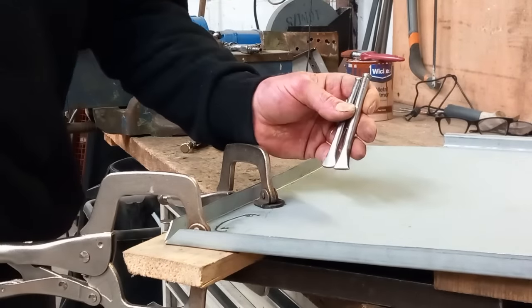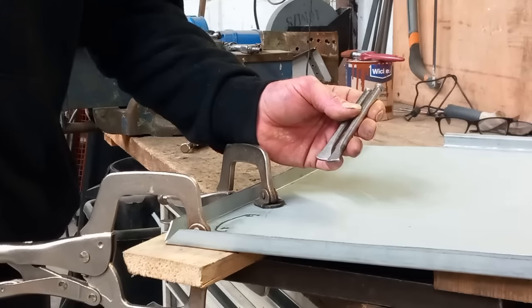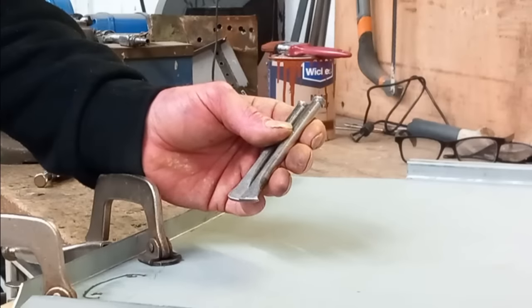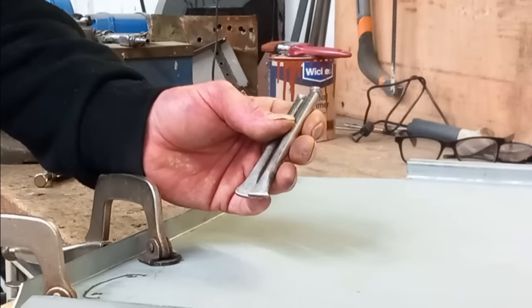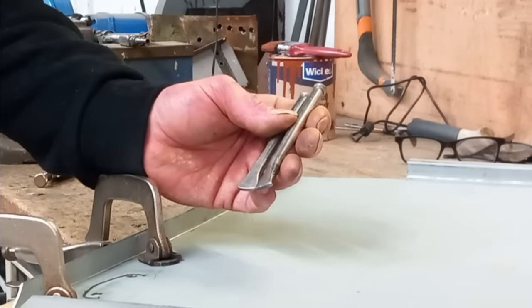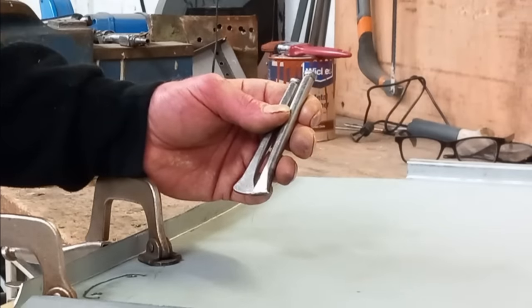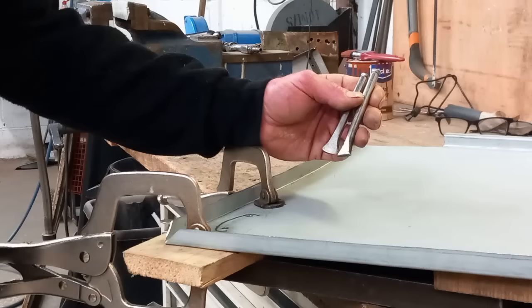I made these chasers over 20 years ago, made from Aston Martin V8 valves. They're nice and hard. After I've reshaped them, I tempered them so they don't shatter when I hammer them. And I made them originally for chasing in the recess for the Aston Martin wings badge on a boot lid I was making for a Virage. Interestingly, a little bit of that process was filmed for Top Gear.